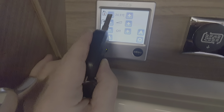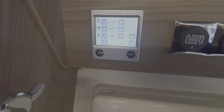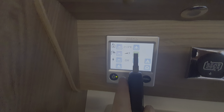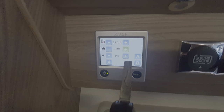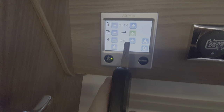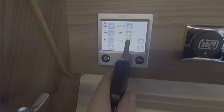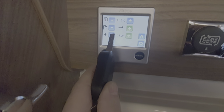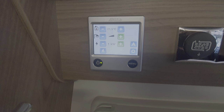Room temperature shows 22 degrees. The next one down is heating for your hot water — you can select that level. I would just leave it on the highest setting and mix it with cold so you've got a lot of warm water. This selects your fuel — this one is electric, and you've got the ability to change your wattage.